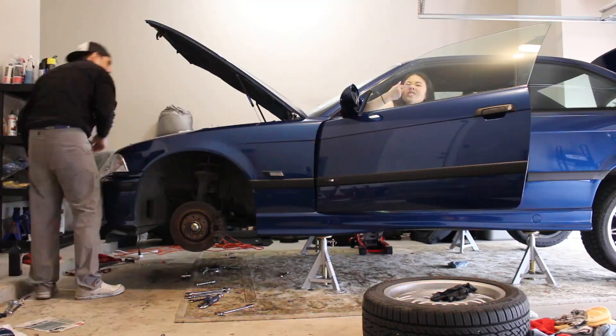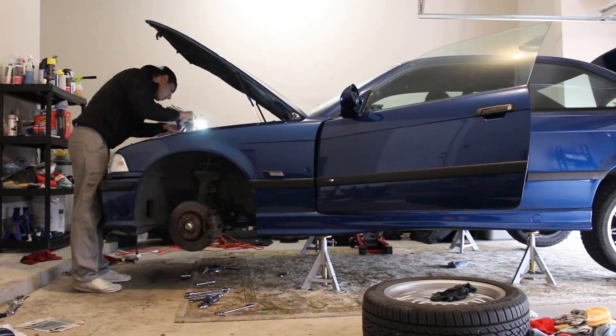Finally done. Now time to fill the system with fluid and crank the wheel from side to side. I'm enlisting the help of my beautiful fiance for this. As you crank the wheel, fluid will go down obviously, so you'll be pouring more fluid in and just back and forth. Now I've just got to go back and tighten everything up — the tie rod ends need to be torqued down, the clamp that goes around the steering column needs to be tightened. It was at a weird angle when I installed it so I couldn't get an open-end wrench on it. I'll button everything up, double-check everything, change the oil, and she'll be good to go.